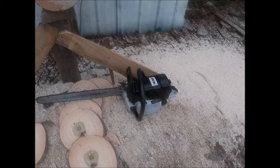And I've shown, I didn't really do any port work. I polished the exhaust port. I took 5 thou off of the base of it, went in and put a little bit of texture, like a 60 grit, on the lowers and the intake port, and I raised the uppers. Not as much as it would need, but when I pull it back off, I don't know when it'll be, I'm going to run it some as is.